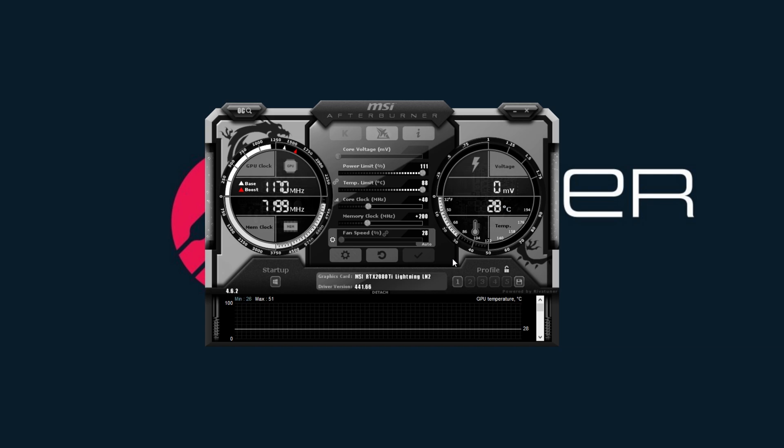I'm going to show you my overclock with the GPU in this build — it's a high-end 2080 Ti Lightning Z. As you can see at the bottom it says LN2, so the BIOS we're using is the LN2 BIOS, which is one I flashed on the GPU. If you really want to get into overclocking, a lot of GPUs will have a BIOS specifically for overclocking. It's more for the enthusiast-level cards — 2080 Ti's, 2080 Supers and so on — rather than mid-range cards. The 2080 Ti Lightning Z had a specific BIOS for it, especially when it's water-cooled.